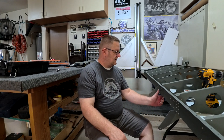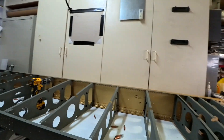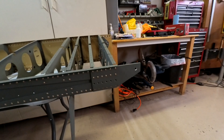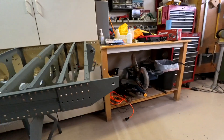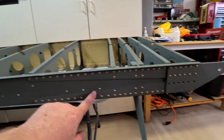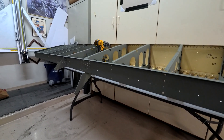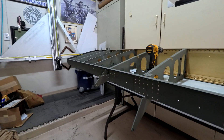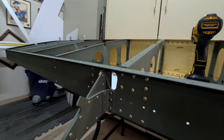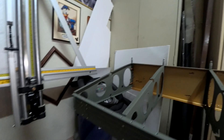That is it — rear spar is done. Let me show you. The rear spar is all attached, the hole is reamed out nice and pretty. These holes don't get filled in yet — that's the flap and aileron area where a piece of metal fits for airflow. The service bulletin aileron hinge is on there, and that last rib actually gets attached in the next section, the top wing skin section.